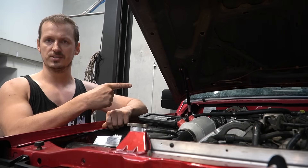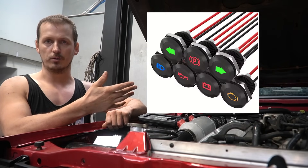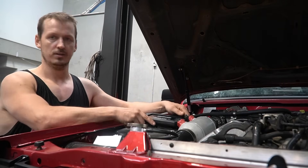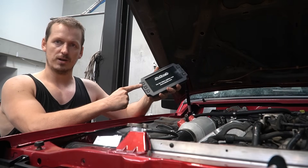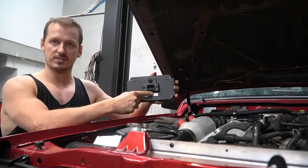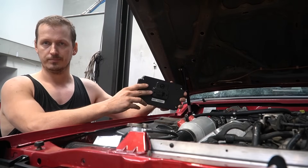The other reason is, since I'm using Nissan Patrol controls like indicators, headlights, handbrake warnings and such like, it means that these are obviously not going to work with the Canbus system, seeing as it's a separate circuit. So the good thing about this is that I can have all the OBD stuff coming to this to display my check engine lights and engine stuff. And seeing as it has a heap of extra wires and pins on the back, I can then manually plug in speed sensors, all the lights that I need, and anything else I may need in the future. So that's why.